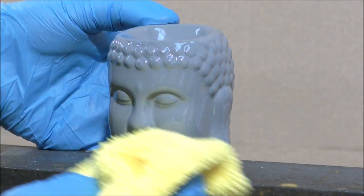When the Direct Gloss has been applied, there's no need to scotch the surface, because as long as the silver has been applied within the 24-hour window of applying the Direct Gloss, the solvents within the silver will slightly eat into the gloss, giving the adhesion that's required.